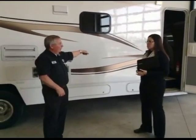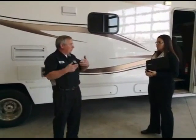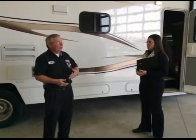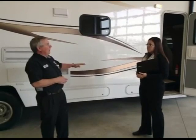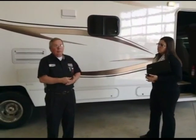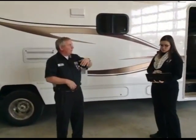Okay. All right. Is there anything in specific that we should do, like with outside showers or that type of thing? That again is one of the faucets that you will run when you're de-winterizing it. You're going to run both the hot and the cold in the sink in the kitchen, in the sink in the bathroom, in the shower, in the toilet, in the washing machine, in the dishwasher, outside sink, water heater. You want to flush everything out until there's nothing but clean water coming out.